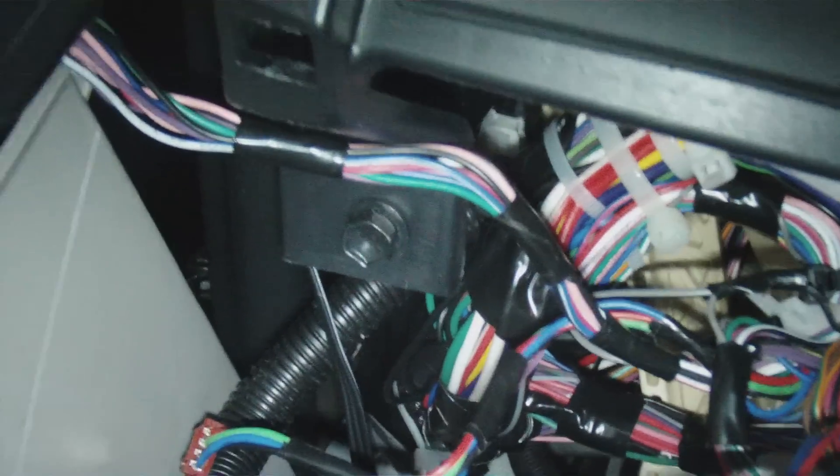Today's video is about programming the bypass used for the smart key, which is the DBL by Express kit slash DEI. It's a pretty good unit — does everything as far as bypass immobilizer, push-to-start, remote start. I'm not using the data wire because I did things the hard way, and that's the only way to do it with an aftermarket remote start unit. It's basically called a W-to-W system, which is a wire-to-wire system.